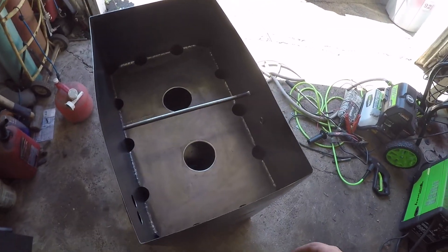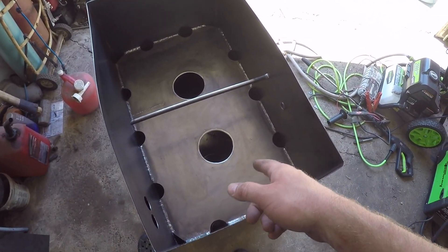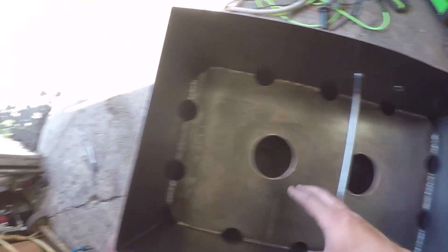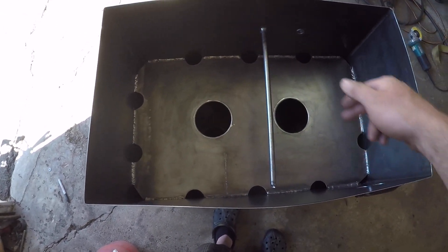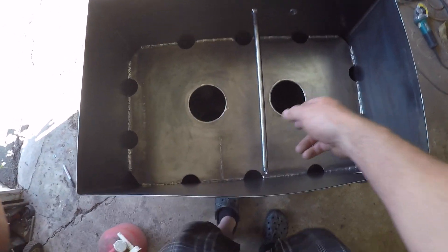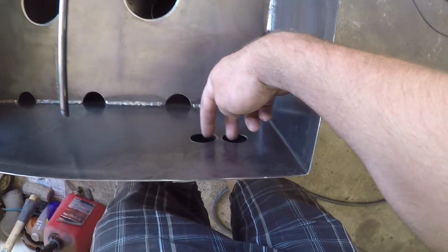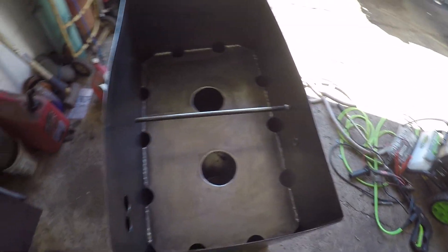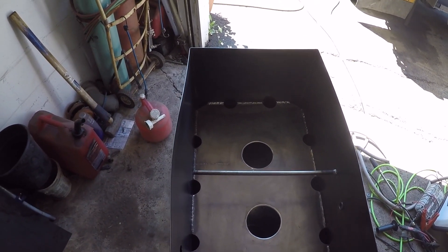I figured I'd give you a shot inside the tank before I close it up — chances are I'll forget what it looks like and have a problem later. You can see the baffles — lots of holes around the outside and two big ones in the middle. The only thing I wish I'd done differently is I made both baffles exactly the same. It's kind of nice because I can reach all the way to the bottom, but if I'd put the holes at different spots on both baffles it would work a little better. Still, it'll help hold the tank together and keep the fuel from sloshing. My fuel return comes all the way down to the bottom of the tank so we're not aerating the fuel. Where the sump is, there are two holes to let fuel down into it. It ain't the prettiest — you can tell it warped a little — but when I put the end cap in I was able to pull it back together and make it look a bit prettier.